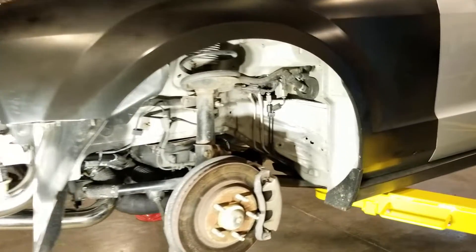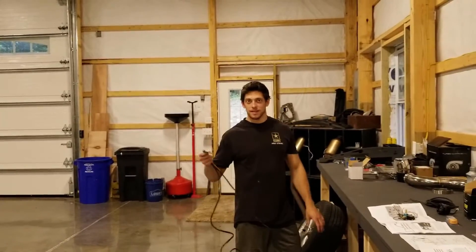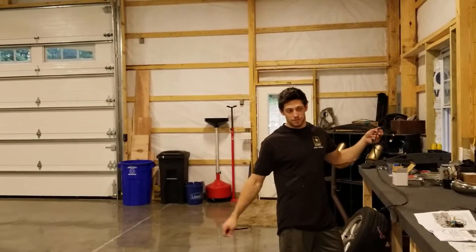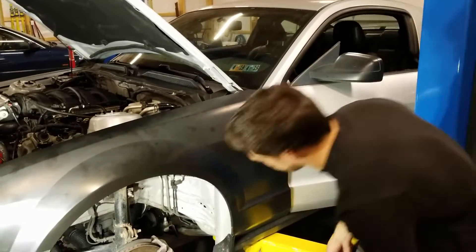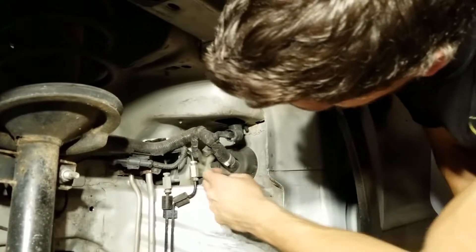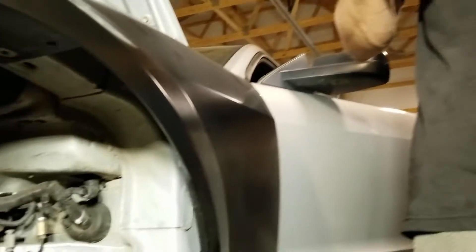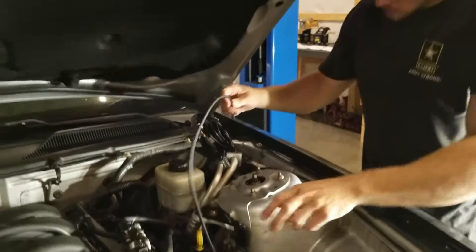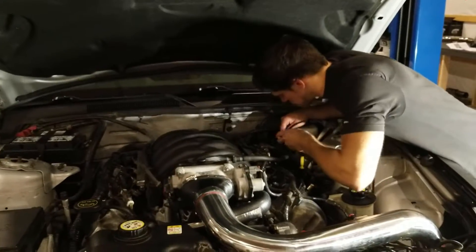We found a big grommet to use - that's the biggest grommet I've ever had. There's a joke about the "grommet guy" - they should have had the grommet guy on designing the heads and spark plugs. We found a great grommet and it goes right into the footwell next to the pedals, and it already has a little spot for adding more cables. We're going to use that. This is the line for the boost controller gauge part of the boost controller - we're just going to cut that and route it through.